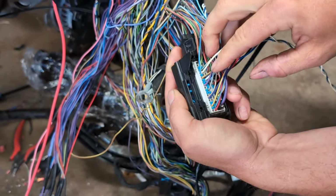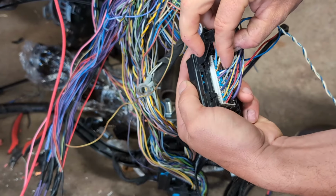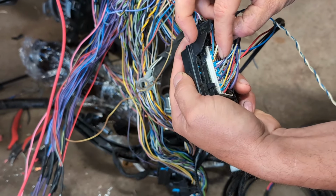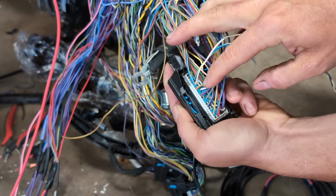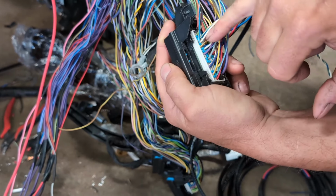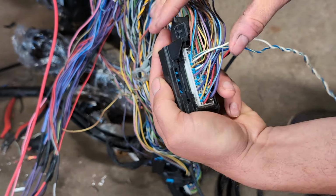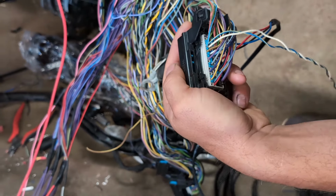And then you'll have an opening, a free hole, and then you'll have your CAN bus network for your ECU and transmission. That opening right there would be your fuel composition sensor. It's like E85. That's what could go there, but that's exactly how it should look. So you get your CAN bus wired in.